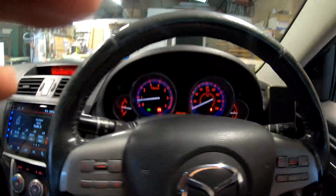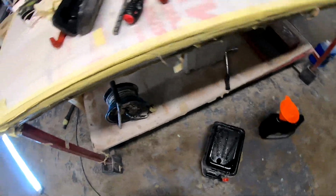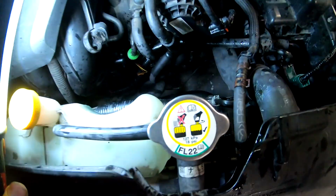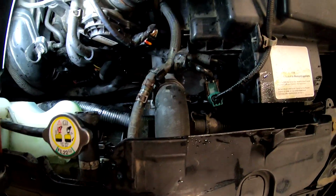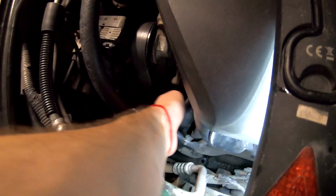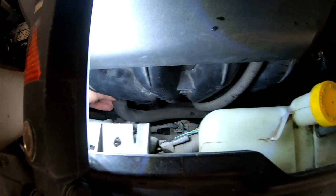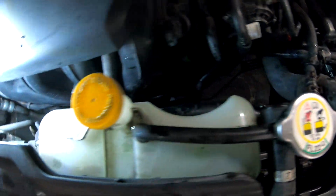Okay, let's switch off the engine and check under the bonnet. So everything is now warm. Oh yeah, that's hot. Alright then, what we want to do is check all of the hoses, to see if all the hoses are literally hot. Oh yeah, that's hot. It's steaming off even from the bottom one. Okay, this should be hot. That's hot, and this? That's warm. That's the same hose.